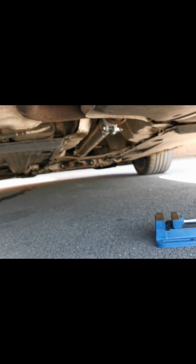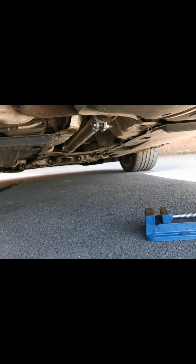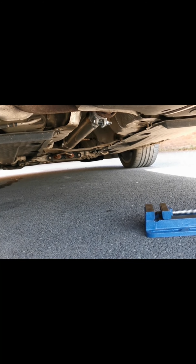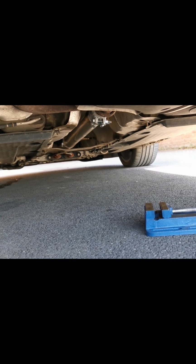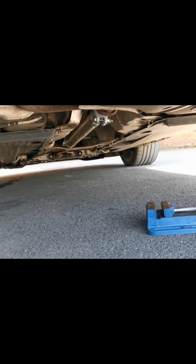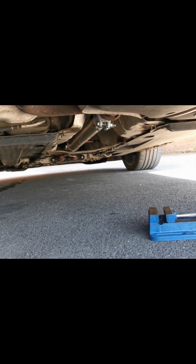I am planning on changing the downpipe, which is all the way down there, with that bit from here. As it goes up to the turbo, a lot of people change over to 3.5 inch, which is literally just a 90-degree in 3.5 inch, then reduces down to 3 inch anyway. It just aids spooling of the turbo and stuff like that. So that's a later on thing. Once all this exhaust is done, I'll get that changed and welded up as well.